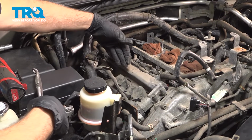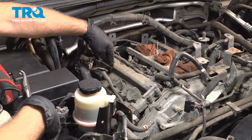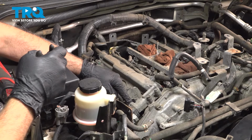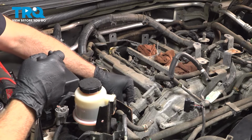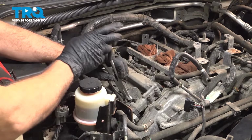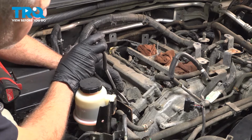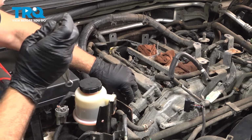On this side here, we have 3 ignition coils, 1, 2, 3. We had to remove the intake to get to these units. Now I want to go ahead and remove a coil. So we're going to start by disconnecting the electrical connector here. There's a little pinch tab on there, and if you have a limited amount of space as we do, you can use a pair of pliers to reach down there, gently pinch the locking tab on that and wiggle that off like so.